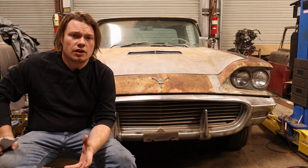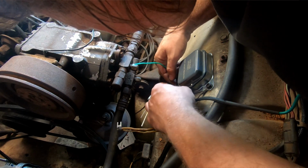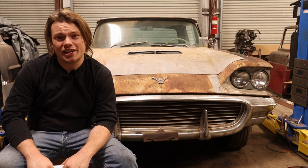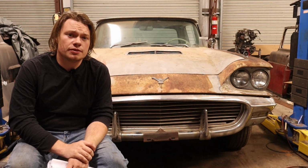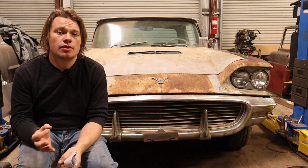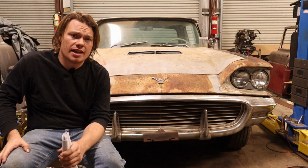So now it's time to move on to wiring, and I just removed the old regulator and I swapped it out for an electronic regulator, which is a big upgrade. I was able to reuse the wires to the generator. I just had to change them up a little bit. Now, if you look down in the description, you will find wiring diagrams for both GM 3-wire alternators and also for the Ford externally regulated alternator that I am using.